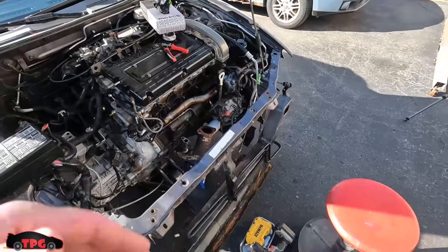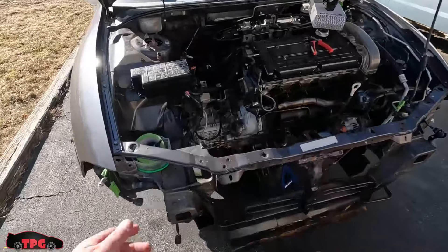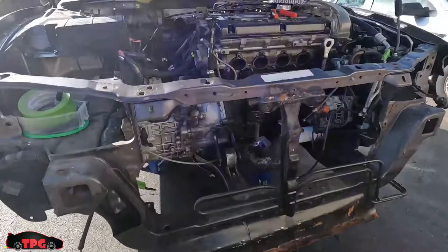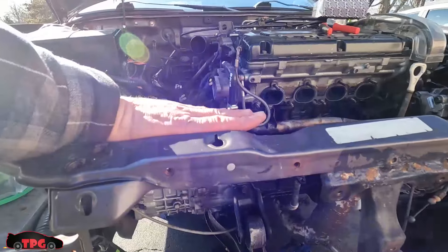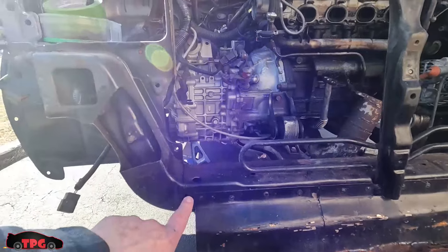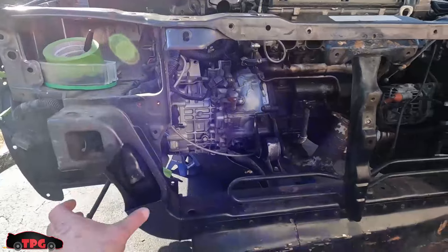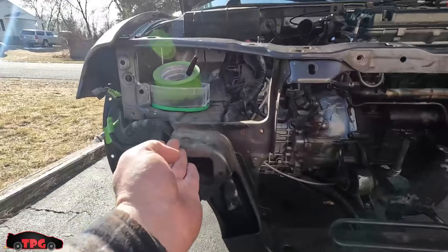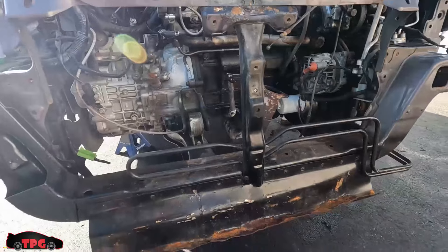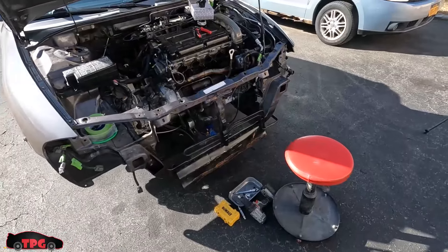If I'm going to go this deep with it, I might as well take my compressor housing off and clean that up. I've got to weld a 90-degree on it. We're going to build ourselves a tubular front end out of some thin wall tube that I have - it's thick enough, same thickness as the sheet metal. I want to make this front end tubular mainly so I can fit my intercooler correctly right in the center. I want to drop my radiator down about an inch and a half. When your radiator is installed, it sits right up against the back here and comes back about that far, and I want to tuck it. I'm going to basically take this ear off on both sides - the whole lower core support, the center section here. We're going to fab up something that's more boxed in, extend it out. Instead of coming and dipping in like this, it's probably going to come in about an inch, then straight down, curve 90, and copy it on the other side. I'm hoping that's going to give me enough space to have my intercooler sit in here correctly and then possibly add some supports on the sides and box in the area where the cooling is supposed to happen. There's going to be a lot of stuff we're going to be doing for this, so it's going to take quite a long time.